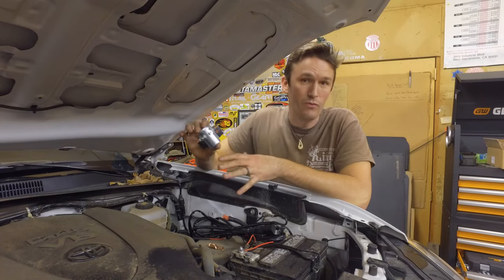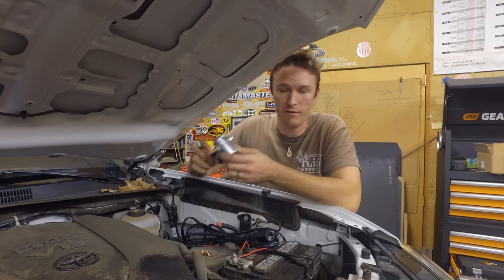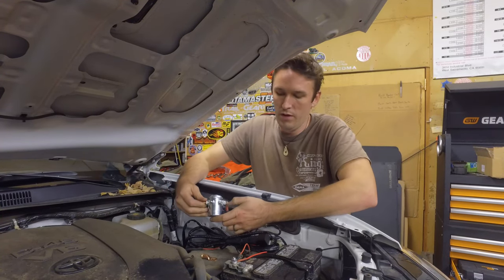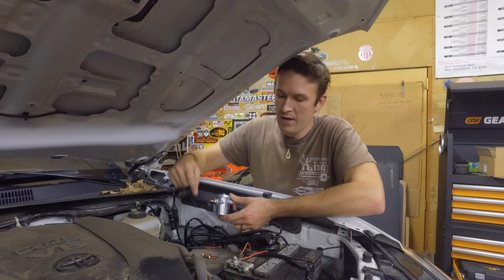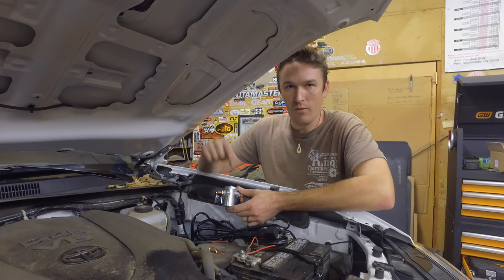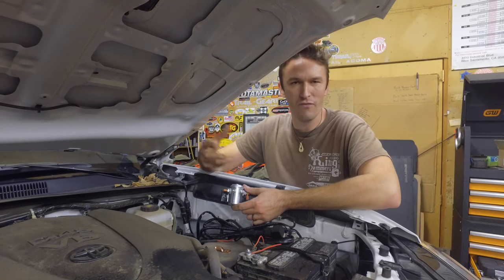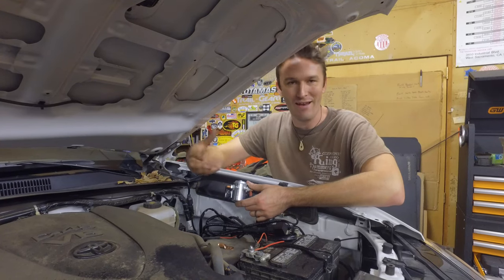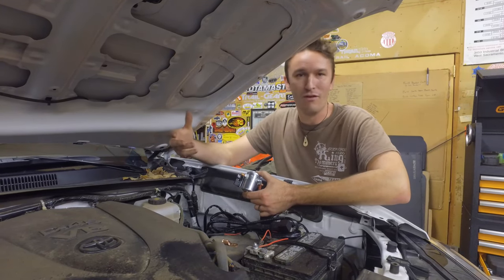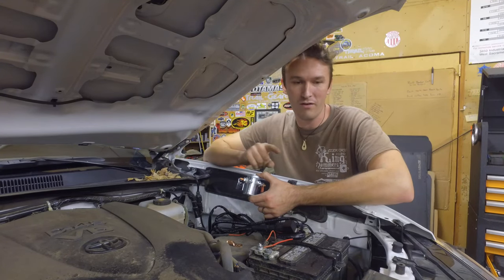Anytime you're setting up a winch, there's lots of different ways to do it. My favorite way is by getting a 350 amp solenoid — you can get these from WARN or find them on Amazon. These are essentially a really big relay: power from your winch comes into one side terminal, and power goes from the other side terminal out to your battery terminal. The two small terminals are the control for the relay, which trigger everything to connect and run to a switch in your cab. This ensures that when you're not using your winch, there is no power going to your winch. Usually if you fuse a winch, you're going to gimp it, because winches will pull more amperage than your fuse can handle. Running a big solenoid means you can shut off power all the time when you're not using your winch, and only have power running to it when you want to use it.